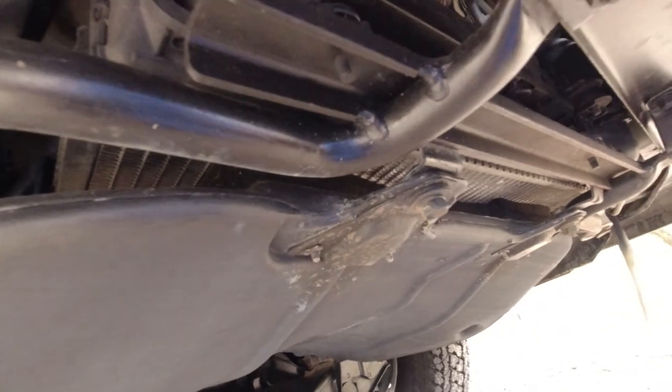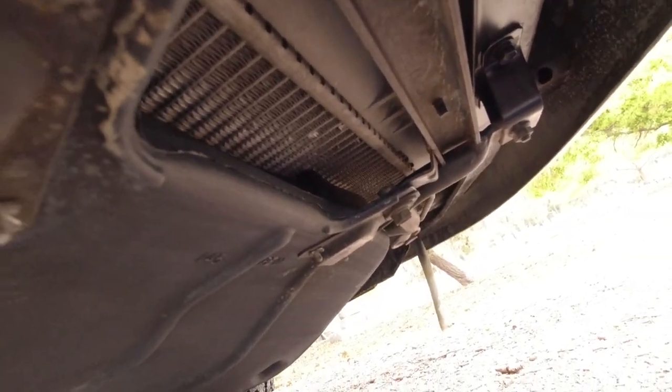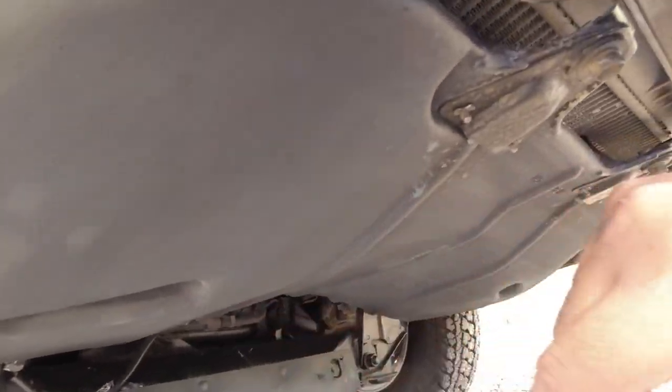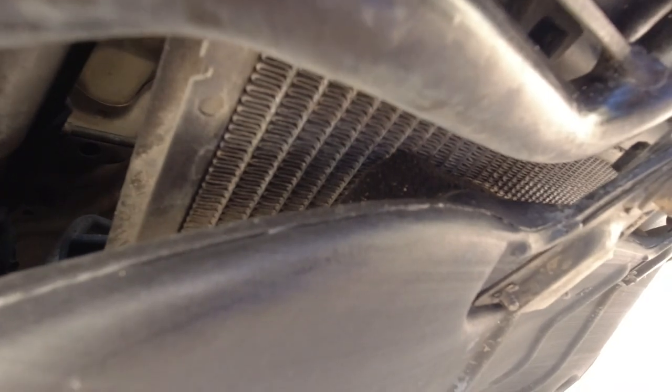So moving on, you have your secondary radiator up the front here when we're talking about the Hiace Super Custom. Again, you want to make sure that there is no visible leaks in the underprotective shroud, and obviously make sure that this protective shroud is in place. And just have a really good poke around at the radiator itself. Are all the fins nice and open, or are they all bent in certain parts, indicating bad workmanship or someone that's been in there doing something?